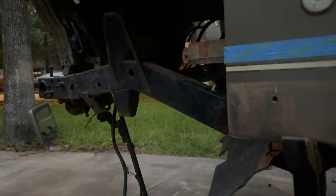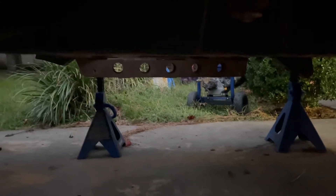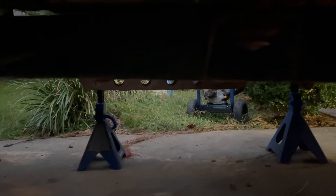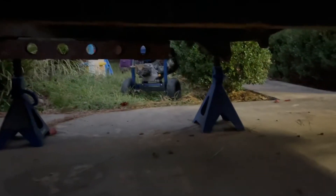By the end of next week we should be in rolling chassis form. This subframe slash belly pan came with the other side — it has that 20-degree lower control arm mount here and a straight lower control arm for the rear. And on both sides we'll have the upper control arm brackets.